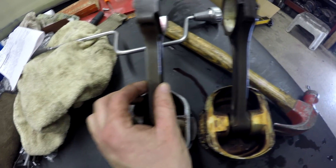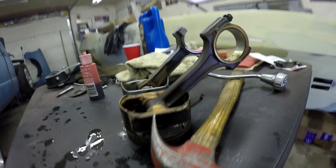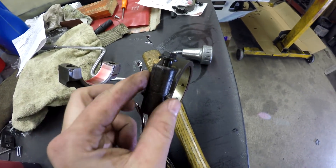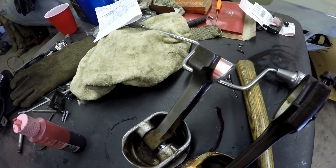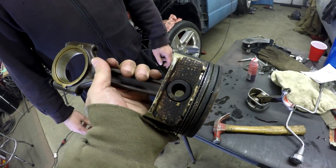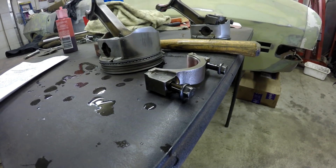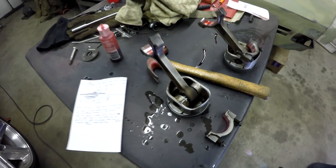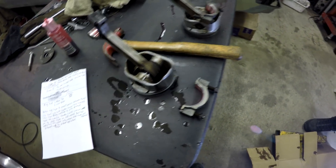The gen 4 rod is a lot thicker and quite a bit beefier overall. On the caps, the gen 3 has a curved edge whereas the gen 4 is all squared off on the ends — that's really the best way to tell. You can also see the different style of wrist pin: the press pin is not as good a design as the floating pin, which relieves a little bit of friction. Rod bolts are a pretty common upgrade on a race engine for high horsepower, but with these LS rods the rod is likely to fail before the bolt does, so getting an ARP bolt seems a little pointless.